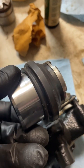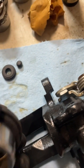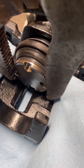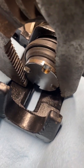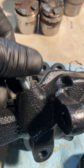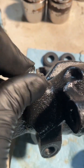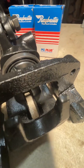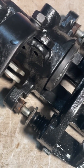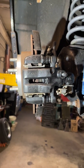Let's take it out for a little inspection. Take the rubber boot and put it over the piston. Now you're ready to put this back in the caliper — just twist it in here with a couple of twists to get it started, and the channel locks will finish the job. Put a new bleeder valve in; you don't want to reuse those. A little rubber cap to keep things tight. And that is it — that's how I've been rebuilding these rear brakes on the Z31. I hope this has been helpful for you all and can come in handy. Take care.